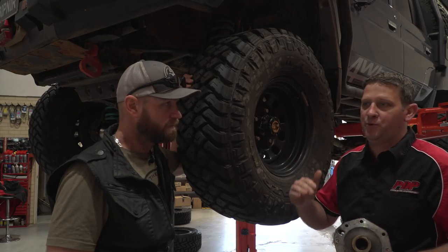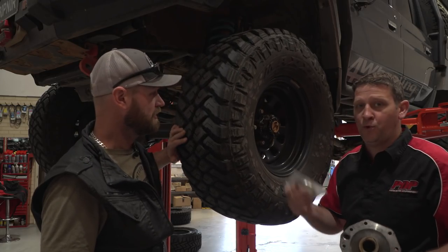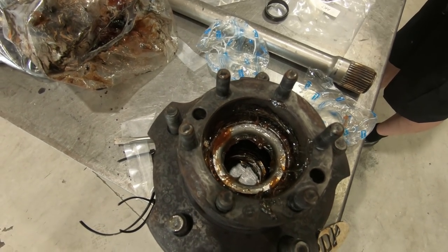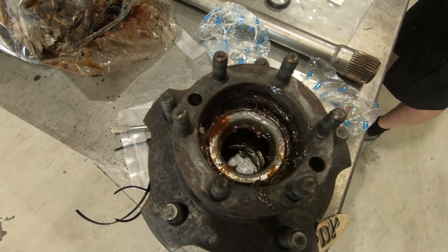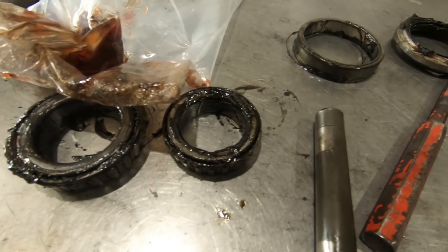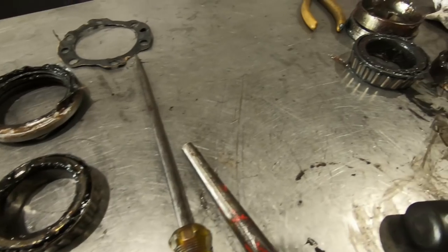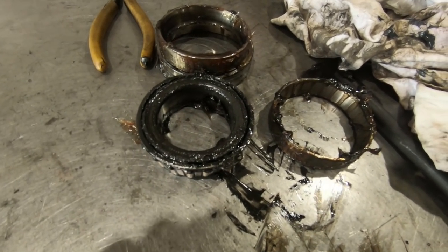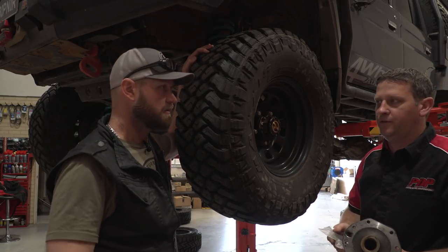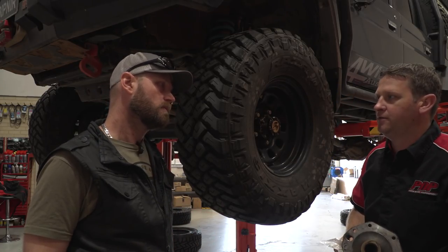The repairs or tow when remote — that's why we didn't take chances. The bearings in Ronnie's car we probably could have cleaned and got away with it, but it's not worth taking that gamble given the weight of what he does and the contamination. We went genuine — the Koyo bearings. We haven't gone for a cheaper branded bearing. Keep in mind the vehicle does get punished, and with bigger wheels and towing there's increased load on the bearings.